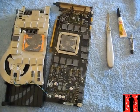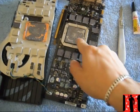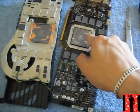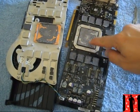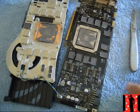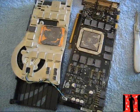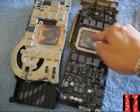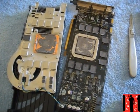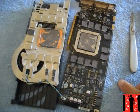I've just opened the card and here you can see the Nvidia GPU. This is the part I will open to show you what it looks like inside. Over time the thermal paste inside gets really hard, which causes higher temperatures than before — that's why I'm doing this.